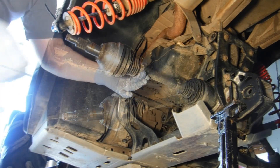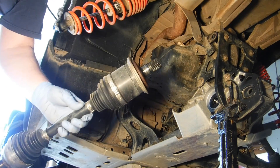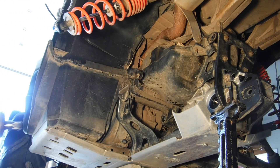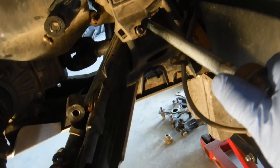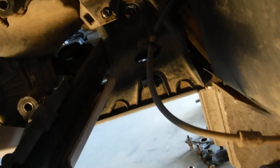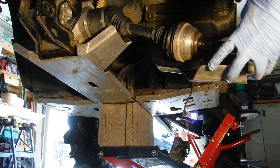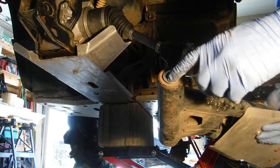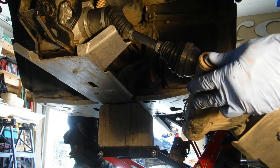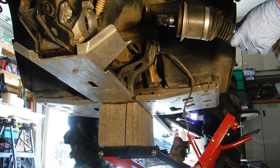There's your whole swing arm assembly and your axle. If it's not seized, it should pop right out — like that. We're going to do the same thing on the other side: swing arm bolt, spacer, the other nut, and pull it right out. Just in case your swing arm falls off the axle — there are two spacers in here, make sure you don't lose those. Axle out.